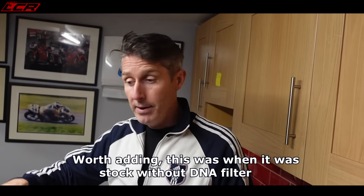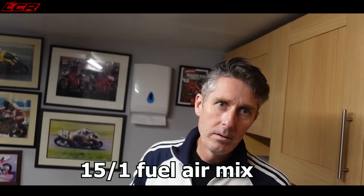The biggest problem with my bike now is it makes hardly any power compared to my 701 before. When you're running around town — small throttle movements, bottom end of the rev range — it cuts out. It's so lean it stutters, which is actually quite dangerous pulling out of junctions; you have to slip the clutch and give it loads of revs. Chris was saying that below 60% throttle on the Euro 5s, they run at 15 to 1 air-fuel ratio — so lean. It should ideally be around 12.5 to 1 for best performance, but because of emissions they have to keep the catalytic converter hot. If the cat cools down it doesn't work properly, so they run lean to keep it hot — and that's the reason they're so desperately lean at the bottom end.